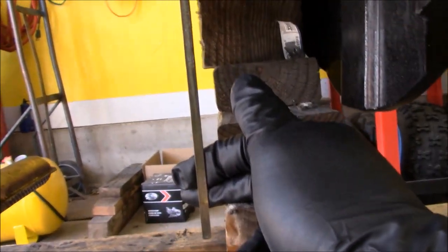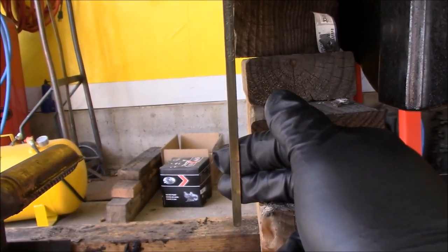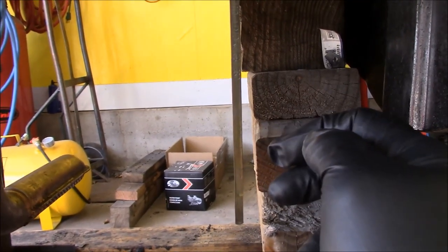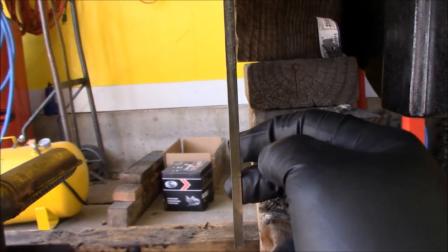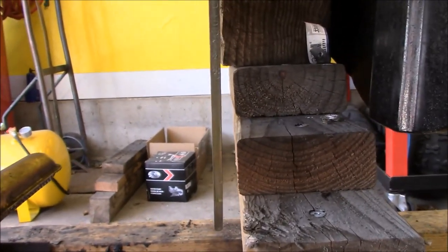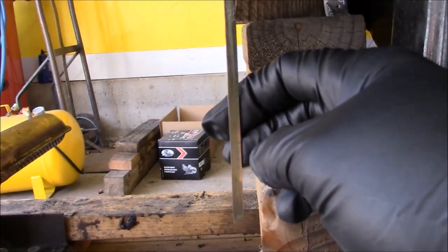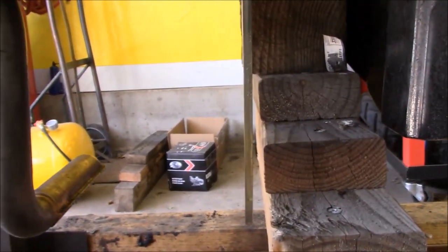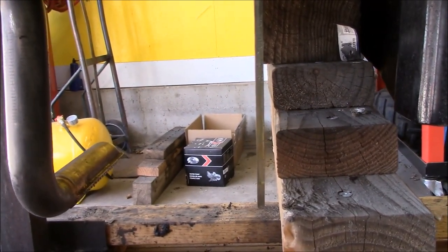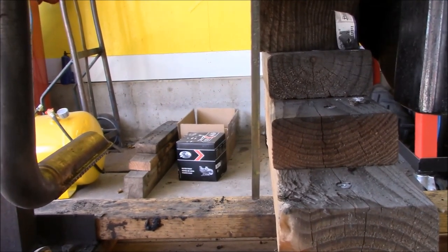What I'm going to do is, when I put oil in this guy for the first time, I'll make sure I look up the exact amount of oil that's supposed to go in. When I fill up my truck with oil, and it's a 24 valve, it uses about 2.5 gallons. But I'll double check and make sure what it is. I'll fill up the oil into the truck, and then I'll check my level, and then I'll put my mark then. Because I just want to make sure it's right.